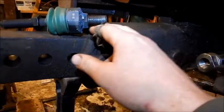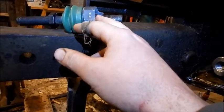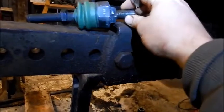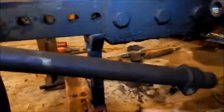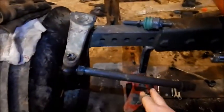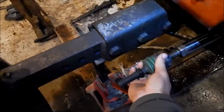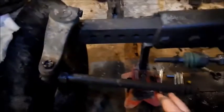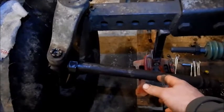This is one-inch fine thread. It fit in there but it wasn't tight, so I just decided to cut it off. I welded the bolt on the back side, centered it up the best I could. Welded that on so it fits tight. Now I gotta cut that tie rod to length, thread this in the whole way, then cut that off. I'm gonna weld another nut on the end of this tube.